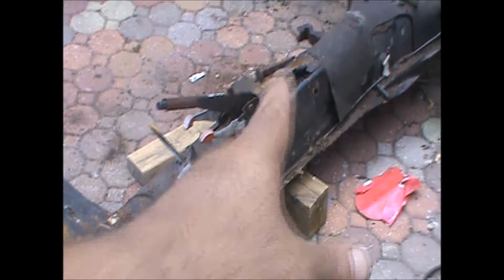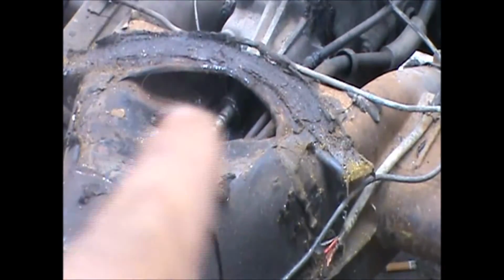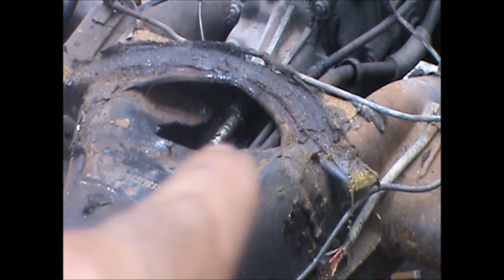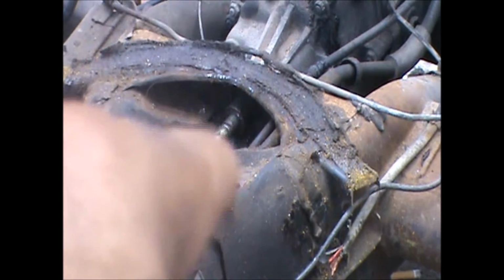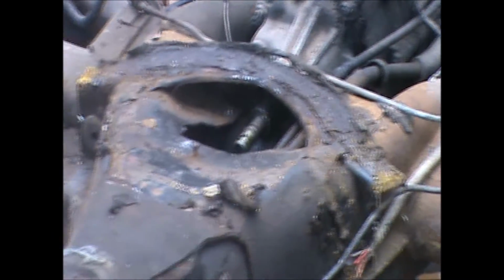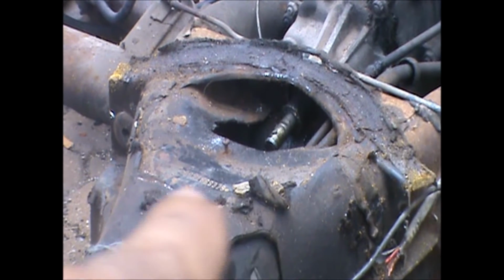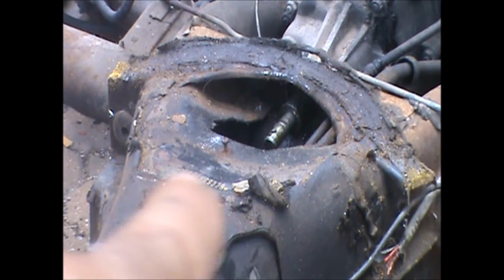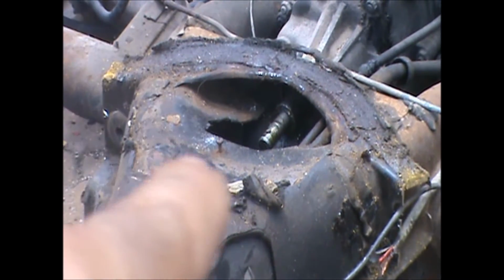If you're getting just the rear torsion out, what you're going to look for is, I forgot the terminology, the nose cone to the transmission is right there. That's where the shift coupler would hook up. If you're going to section one of these for a sand rail, you're going to want to cut right there where that VIN number's at. Come across and just do a rough cut. When you rough cut it, then you'll have a chance to come back and finish cut it.